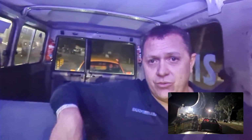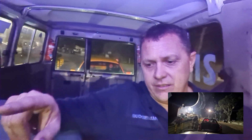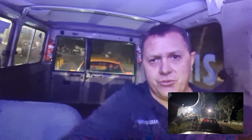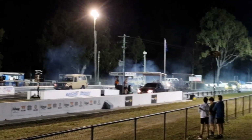But, yeah, oil pressure gauge still doing weird things. I think what I'm going to do is run through a fuse block now, I'll run it over to a different power supply and just hardwire it in on a switch. See if that fixes it. If that doesn't fix it, then I don't know what we do after that. Yeah, okay. Anyways, let's roll forward and see what happens. It does sound better. Let's just hope it keeps going.